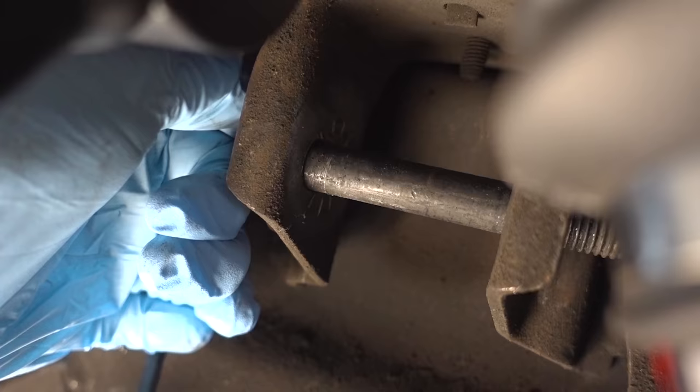I know it kind of sounds like I'm whining here, and I kind of am a little bit, but I'm allowed to — I paid for this thing and installed it and driven it for a very long time. I do want to give a shout out to the Bilstein 4600s — those shocks are absolutely incredible. Another part of this lift kit was four new shocks from Rough Country, and I have to say those shocks were borderline unusable. They provided basically no dampening whatsoever. That freeway example I gave you earlier, when my wheels would leave the ground and chirp — yeah, they were doing that when I was using the Rough Country shocks. Once I put my Bilstein 4600s back on, it largely took care of that problem, not all the way but a lot of the way.